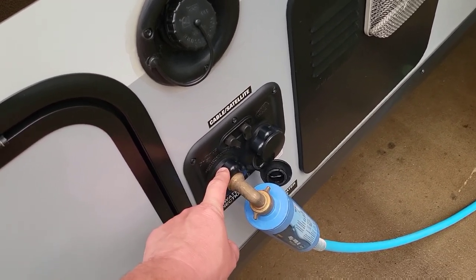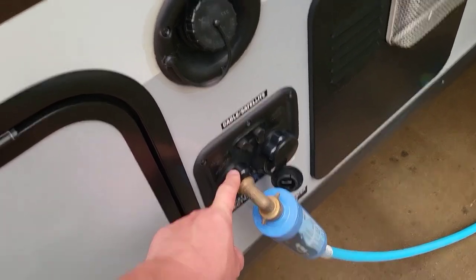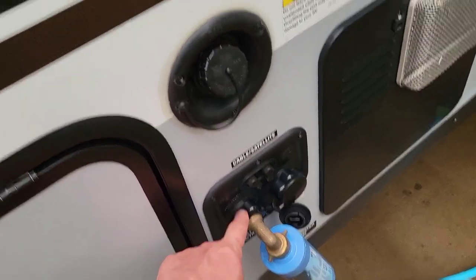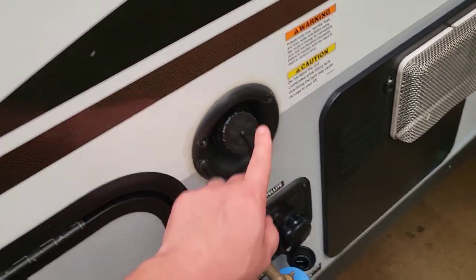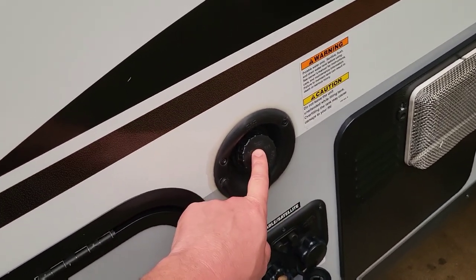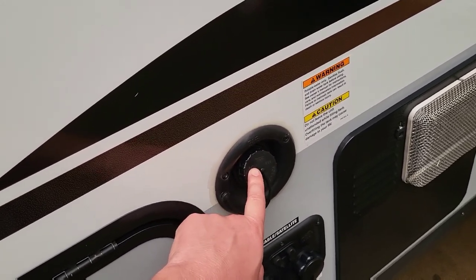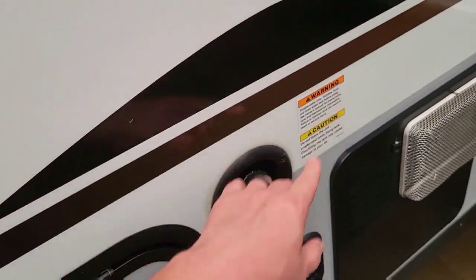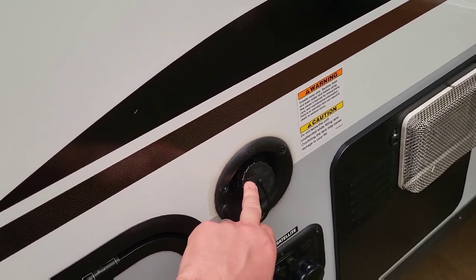City water — if you've got a water supply at your campground, that's where you connect to this fitting. Here is your freshwater tank. If you don't have city water and you need to fill your water at home and take it with you, this is where you put that water. Your water will not work unless you turn the pump on inside — it says 'water pump' — so turn that on with the tank full and it will operate.